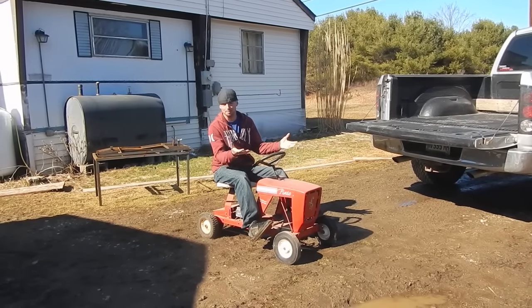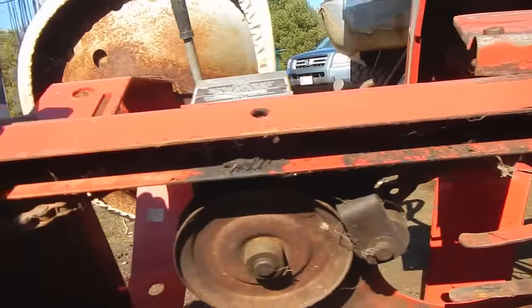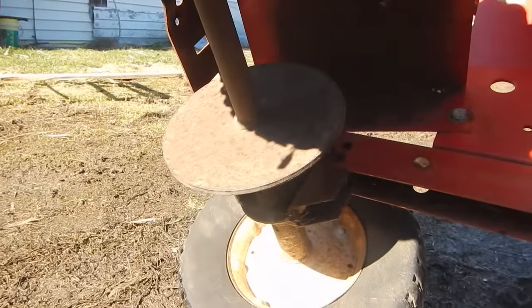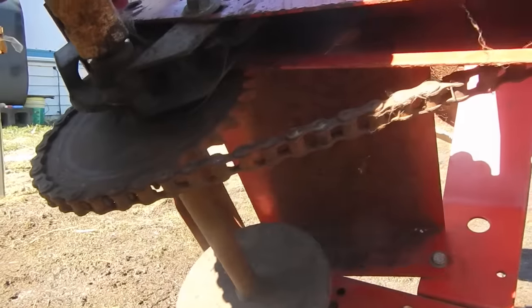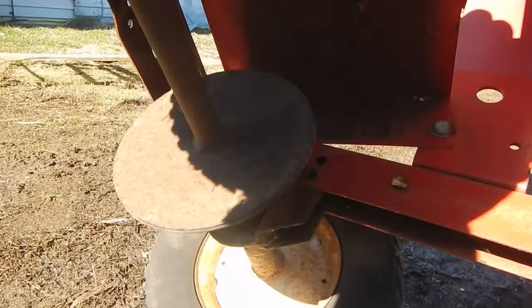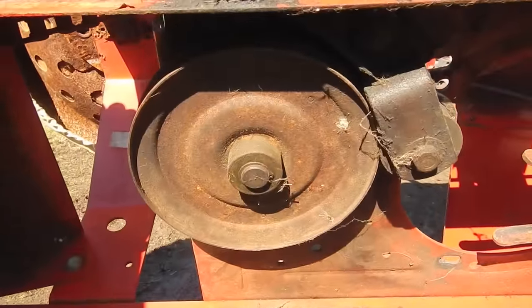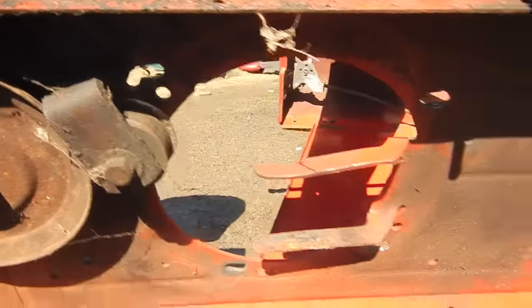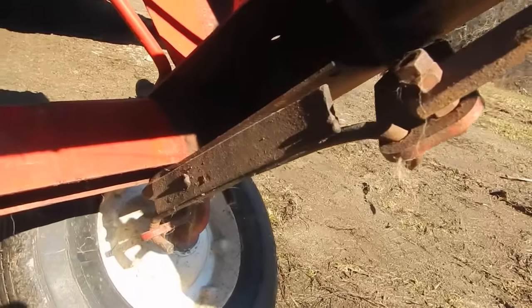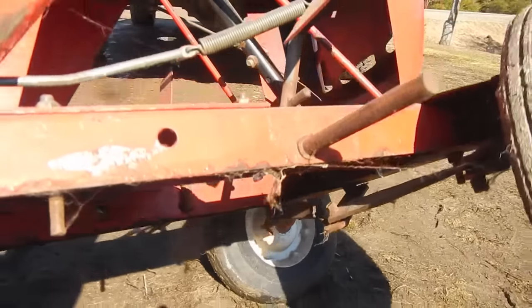You're essentially riding a push mower. Tipped up here, you can see it's got the C-channel frame that my racing mower had — pretty much identical to the racing mower frame. It's got those old school bearings on both sides; they seem to still be pretty good with not a lot of play. Looks like a number 41 chain and sprocket. Old disc brake but there's no caliper. You can see the transmission input pulley and the little tiny clutch. The tie rods definitely look like they've had a little custom work done at some point, but otherwise it's just flat steel — no real major modification.